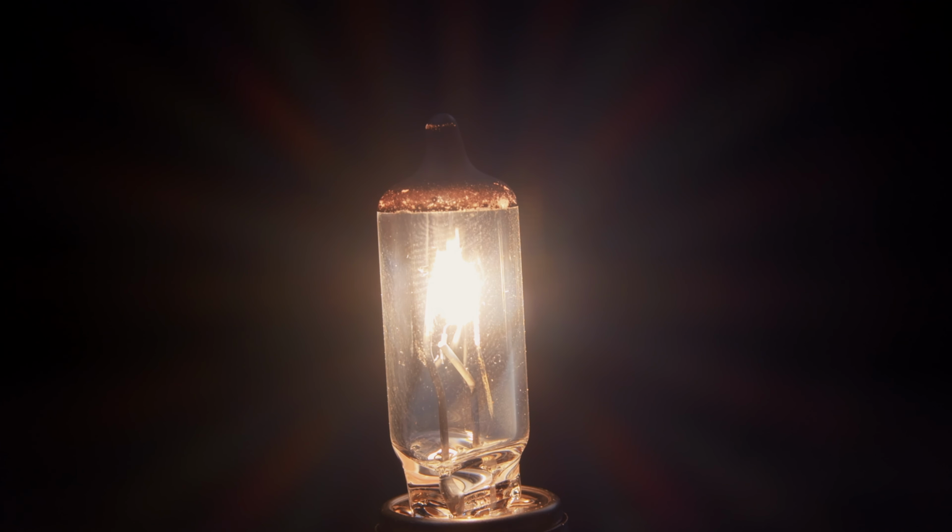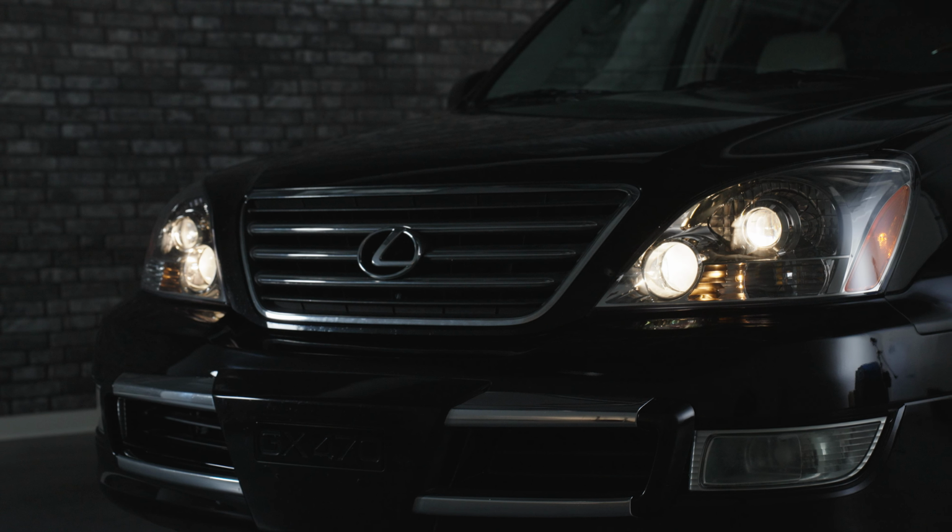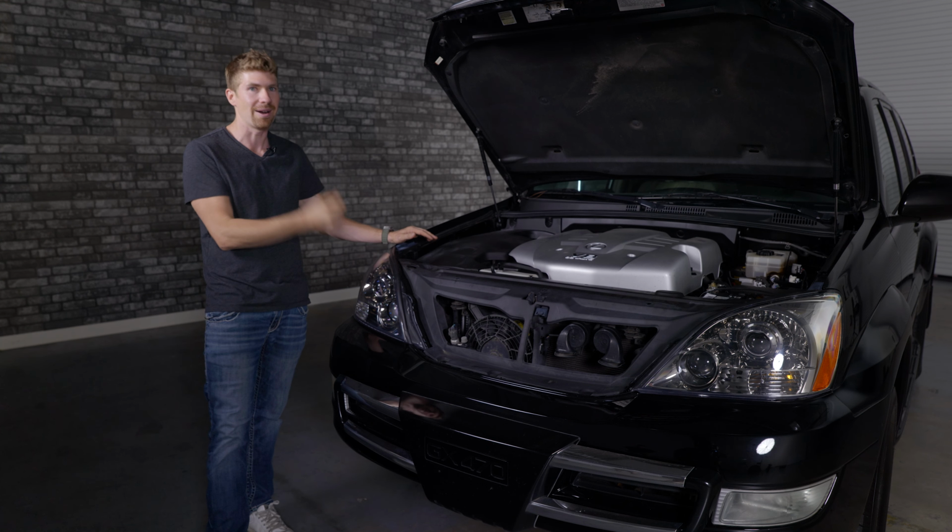The only thing is they put that dingy halogen bulb and it's just garbage. One, it gets less bright over time. Two, you have to replace it over and over and over again because it's going to burn out. It's really easy to upgrade though. So, dive in here, turn that bulb counterclockwise, remove it, make sure you don't burn yourself, throw it away.